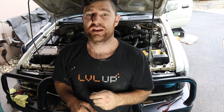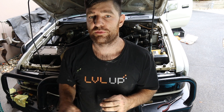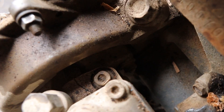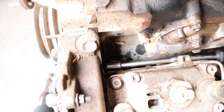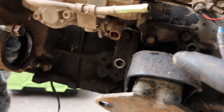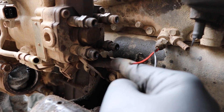Now, it's a bit easier with the engine out of the car for this one specific nut. I've got some footage of that already from when I rebuilt the car. Always start with the hardest bolt first, because then the easier-to-access ones are actually going to hold the pieces in position while you crack the difficult ones loose. If you leave it until last, you've got all the weight on them and it's just a difficult time. So let's clock this fuel pump.